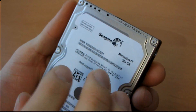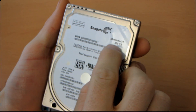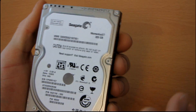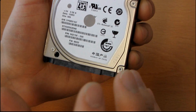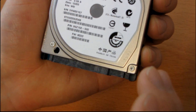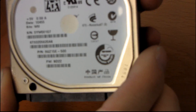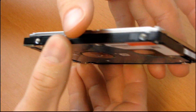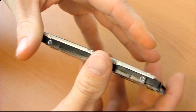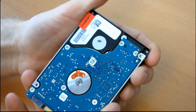What's revolutionary about this is actually what's under the hood. This is a magnetic drive — that's why you get a nice high capacity at a very reasonable price — but it also has a small 4 gigabyte SSD built in. Now that doesn't mean you get any significant capacity boost. The SSD isn't there for storage; it's built in to give you a speed boost. So while you won't quite get the speed of a full SSD, you won't be stuck with the speed of a regular hard drive either.